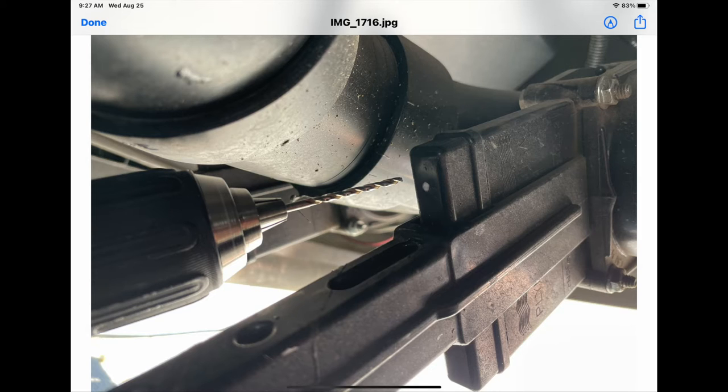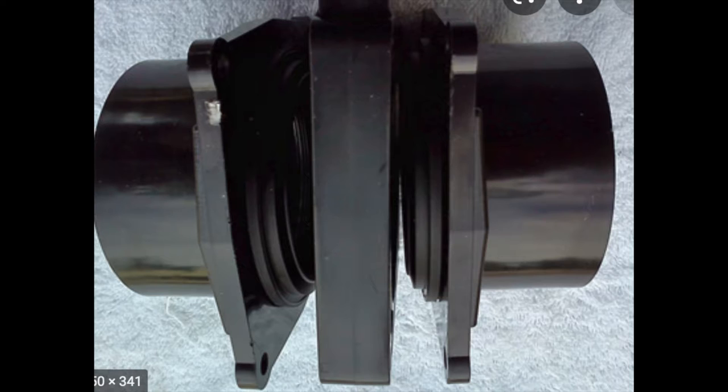We tried the drain liquids — that did not help either. Also, within the valve there are rubber seals that sometimes are not placed correctly. You can open it up and see if that might be your issue; that would actually be a simple fix. For us, that wasn't the case.